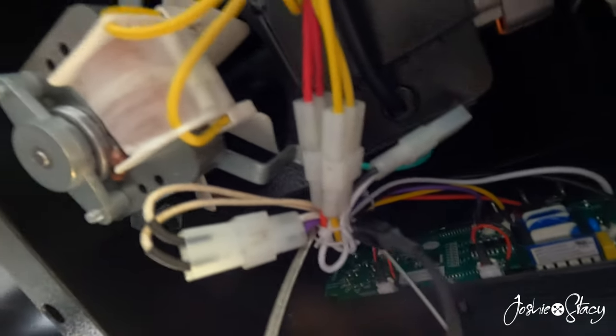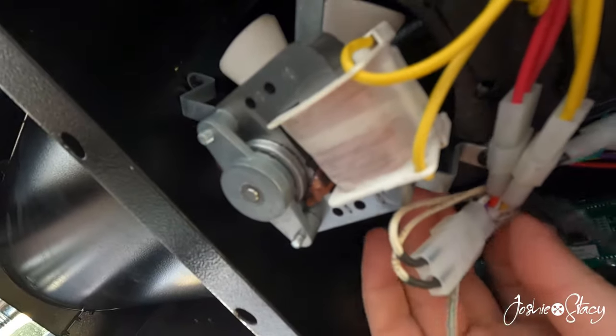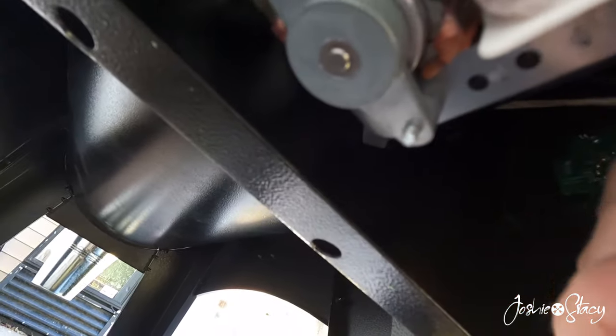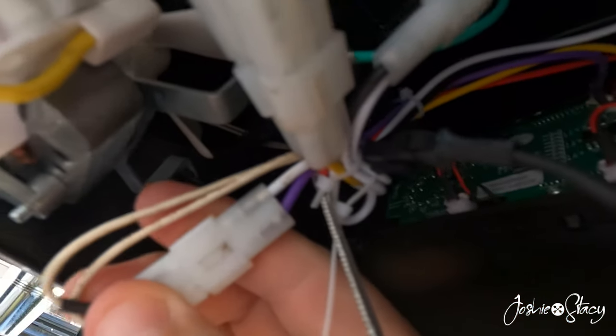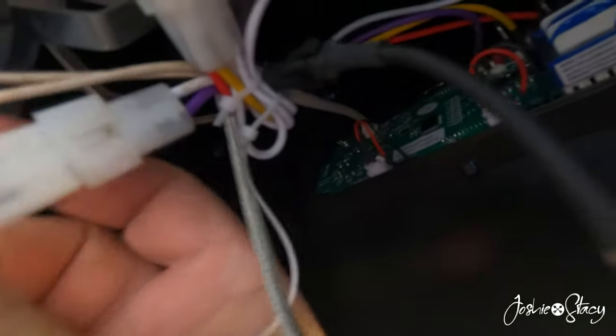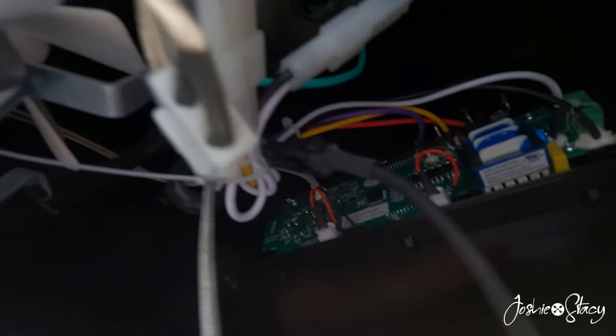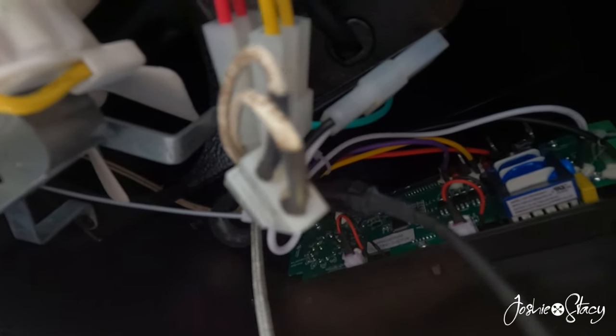Up inside the bottom there are two screws on each corner. We've got to cut this zip tie and go through all these wires. It's this one - the purple and white wire - I know that's it because of the schematics I found online for this model. So we're going to unplug everything, then pull through. Yes, there is a grommet up here - we'll pull that off. The board is up there so we're going to check the fuse on that as well while we're underneath here. This should be pretty simple.